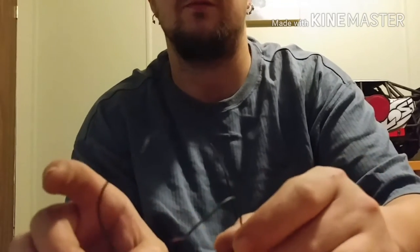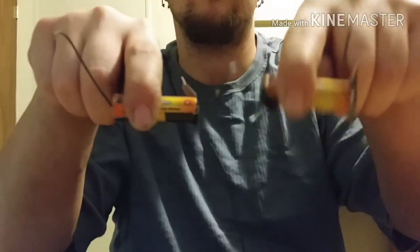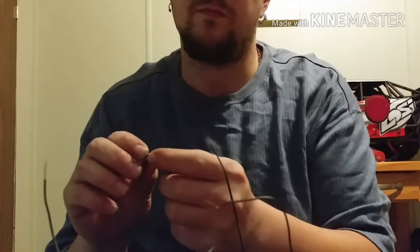I have nothing to get it glowing, so I started thinking: how many double-A batteries is it going to take? First I took one double-A, used some tape to hold some wire on, put it to the glow plug — it didn't start glowing. Then I put two batteries in series. Basically you connect the negative and positive of two double-A batteries — negative, positive, negative, positive — and that puts them in series, which brings the voltage up to an amount that will actually make the glow plug ignite.